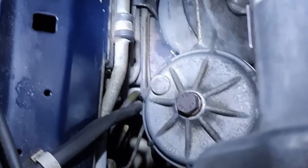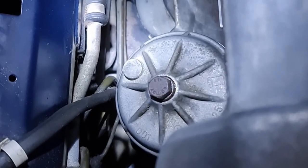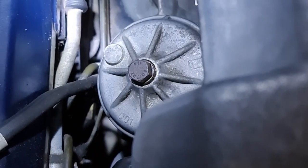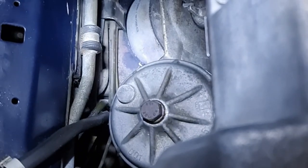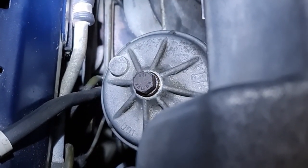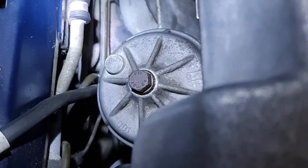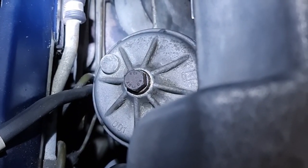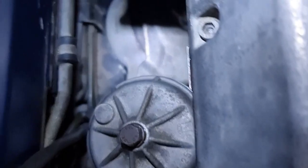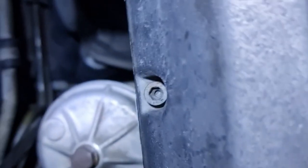The last thing I will do is the first thing I did when I wanted to take off the bolts from the engine mount, and that would be to tighten two lower 13 millimeter bolts for the engine mount. That will be my last thing to do. Now I'm going ahead to put back this piece, the last piece of manifold, and tighten all the bolts.